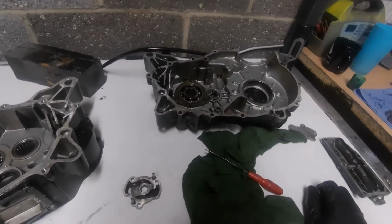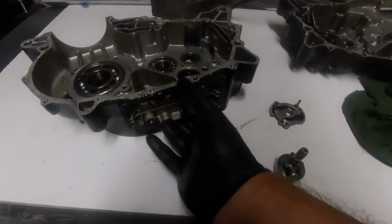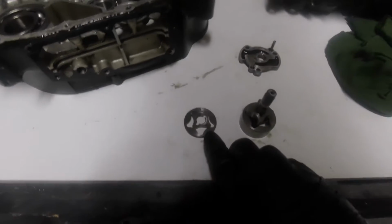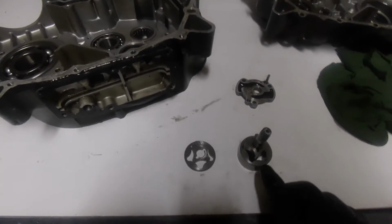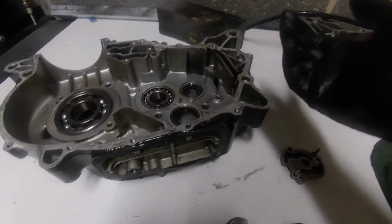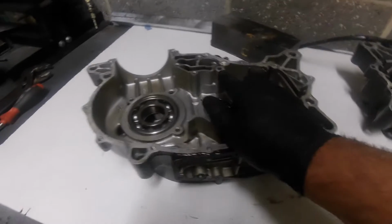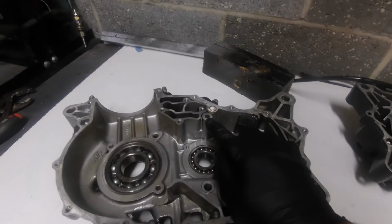Okay, so the situation we've got is that we've got a scavenge pump, this size pump, drawing oil from the bottom, where we've got a quantity of oil inside, sending it up through the cases to this pump. Now, I would have thought there's a situation where that would supply too much to that. So you've got to get rid of some of it somewhere. So yeah, splash feed it over the gearbox or something. So I think the idea's there, but I'm not 100% sure that we know that just opening that port there is what's required.